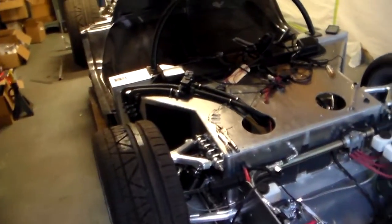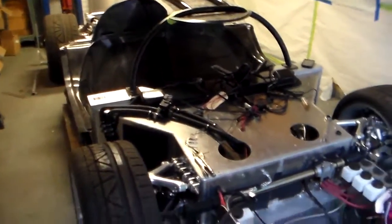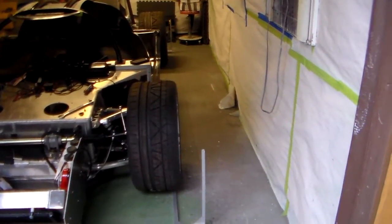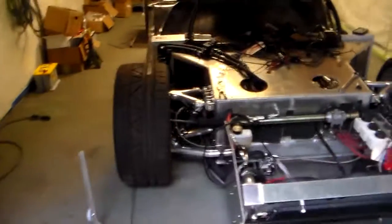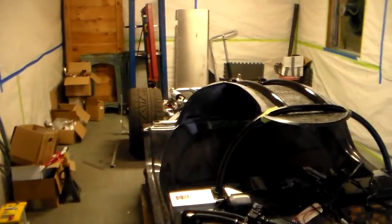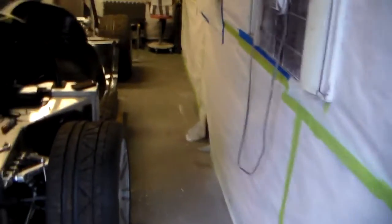So I'm going to go ahead and do all four tires. You can see how the tires are off right now. This front driver is sticking in way too much. The passenger doesn't look bad. The back tire looks pretty close now, and the back driver is off — but you've got to look at that line and see the difference. You can't follow the body because it looks different. You've got to trust the line.